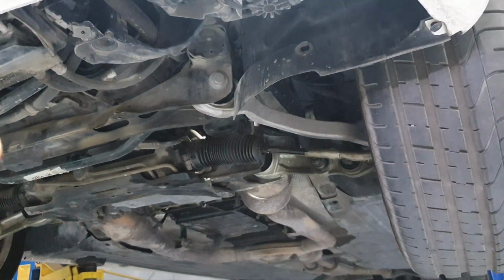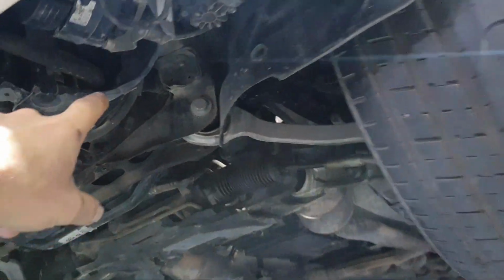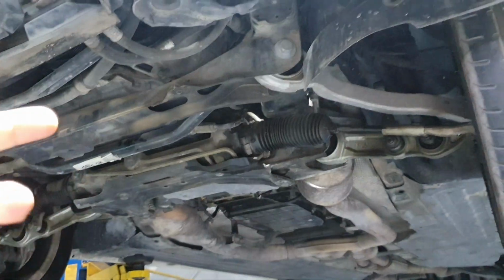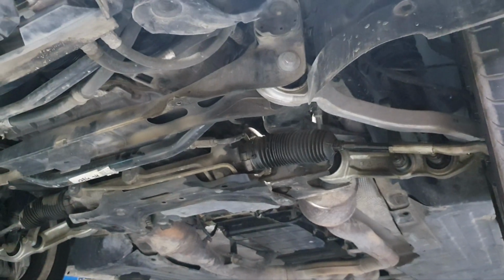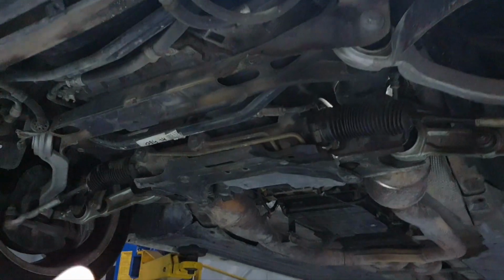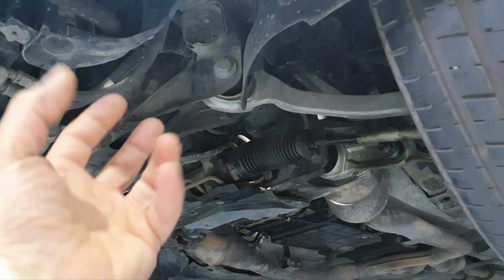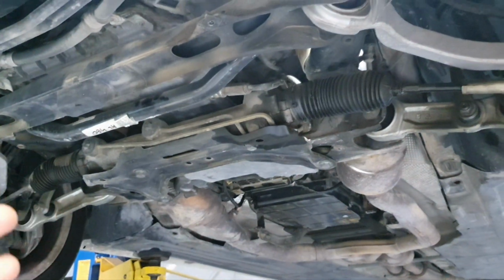And I'm not taking something for granted. Because let us say it happened on the previous E55 that the seals on the timing cover failed. I'm not gonna say, this is for sure timing cover seals. I'm gonna make some checks. I'm gonna check the car. And then I'm gonna see what's the problem. Some people are saying that when you start the car in cold weather and you don't warm up properly, you're gonna collect some moisture, some milkshake color, let us say, on the cap. Yes, but here in this country there's no cold start, there's no winter.